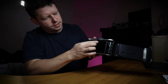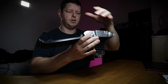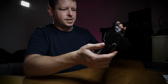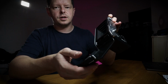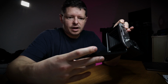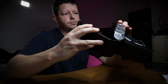It is going to take 6:9 negatives. There's the frame that it is going to expose. It's massive, it's huge, isn't it? The film bay looks relatively clean. These light seals at the end here are in pretty good shape. There's really not a great deal wrong with it. There's not much corrosion. The fact that it was filthy suggests that it potentially wasn't stored with great care, but it has escaped the worst of what could have happened to it. It's really in quite good nick.